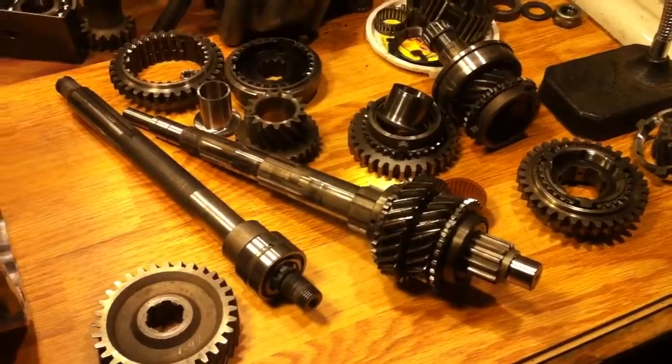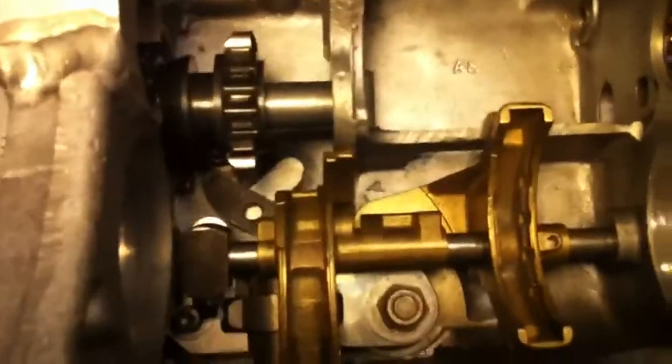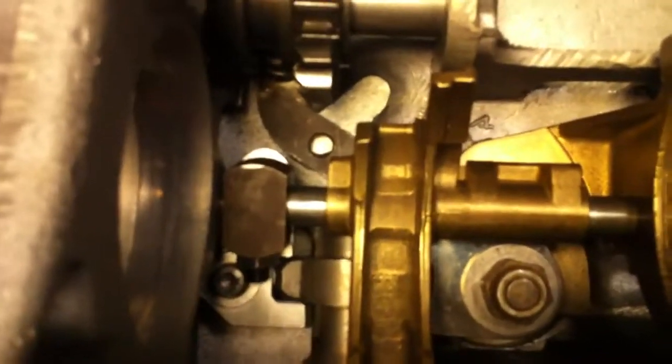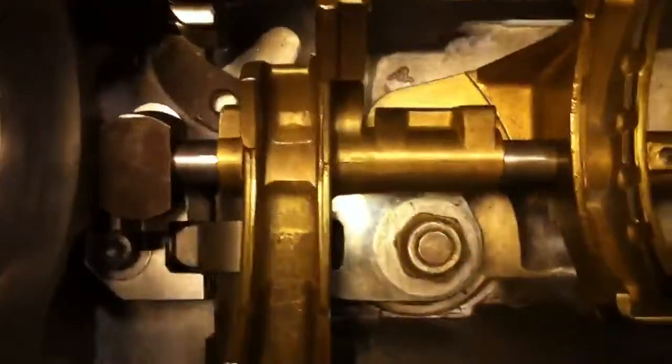As we get ready to put some serious parts back into our 5-speed, let's have one last look at the assembled shift linkage now. All the shift forks are in place. Everything has been Loctited, and the only thing remaining is the set screw for the little 5th gear lock lug that puts it onto the shaft. Let's see if we can get our lighting and our camera to cooperate, at all the gear positions with all the linkage in place.